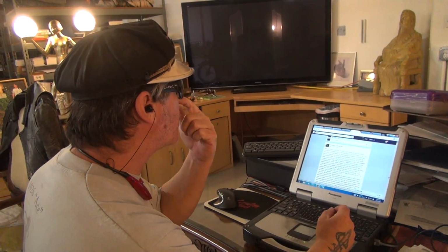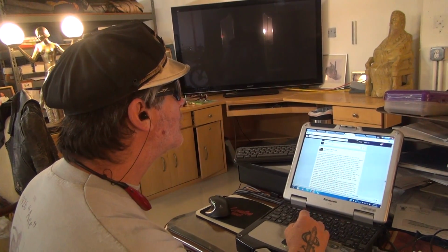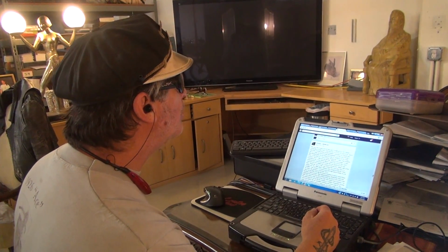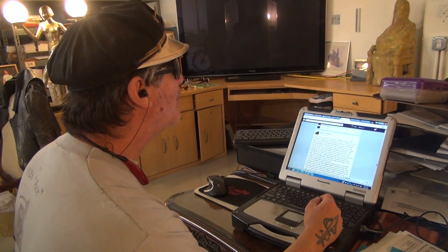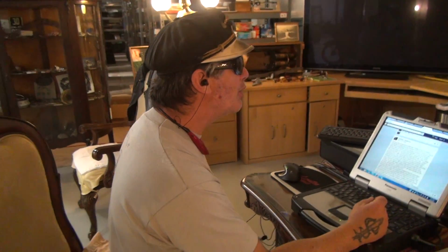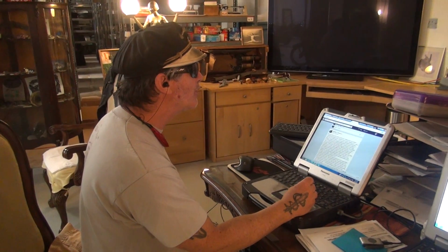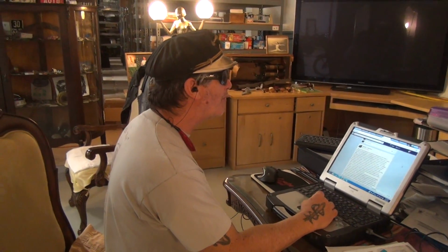About 5 miles into the third leg, I started to lose power. Luckily, I remembered my cousin Jimmy Allison's advice and covered the clutch pedal. I assume he disengaged it, because it went boom and locked the rear up at 60 miles an hour. It looked like the front cylinder was seizing up and tore the cylinder right off the base. Timing was spot on, bike was running well, front plug color is a medium tan, rear a little darker, nothing close enough to indicate a lean condition. I was running 2.5 turns out on a high-speed needle on an M35 Linkert. My elevation is 4,500 feet. What the fuck?